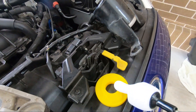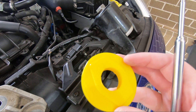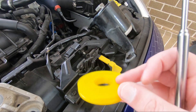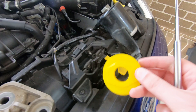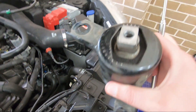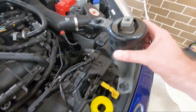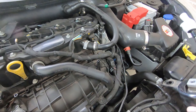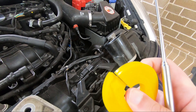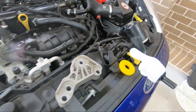We've got our Powerflex mount. As you can see it's got a shape on one side and not the other — that is the bottom which will fit into there. We're just going to refit this with the ring, because this is split and you fit the ring in the groove there, and then refit it back in.